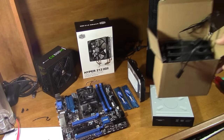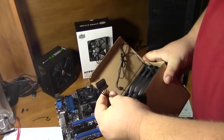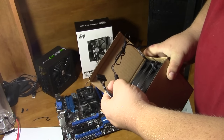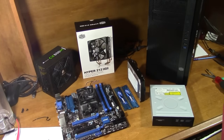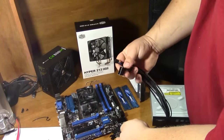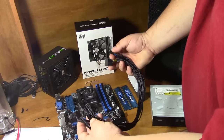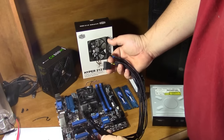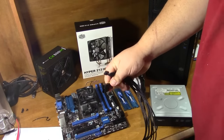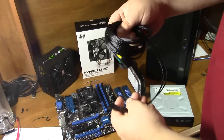Other than that, you just need to make sure you've got all the fans you want, and cross-check all your connectors — these fans run off of a molex, or you can use the three or four pin. I've also got a splitter that runs off molex for power and hooks to one of the chassis fan headers on the motherboard to run five fans off of one header, so you can control the speed of five fans via the motherboard.